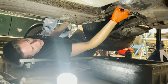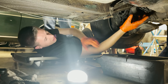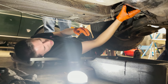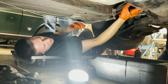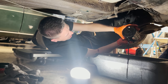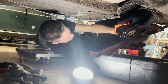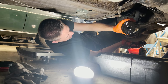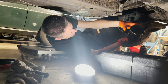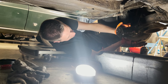Figured we'd take the oil filter off. Hopefully we have some oil in here. It's starting to run, so that's a sign — it's an okay sign. It's super dark, but it's all right. It's a start. At least it's not bone dry. Ew, it is super dark. Oh, it's sludgy. A little sludgy. Hasn't had an oil change in a while, but it's also been sitting. We'll pop the drain on the engine as well, let that drain out and see what comes out of the bottom of the pan. Hopefully this thing's all right.